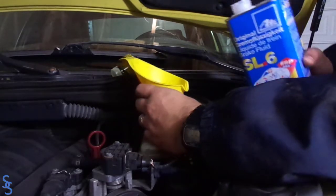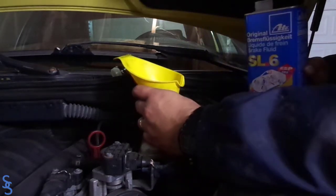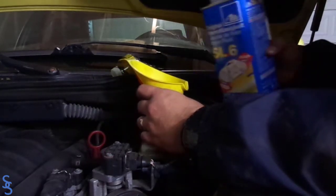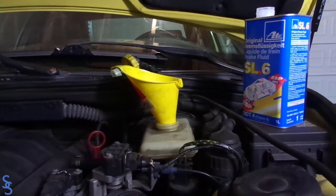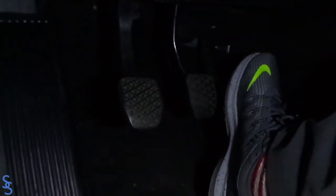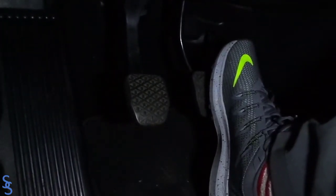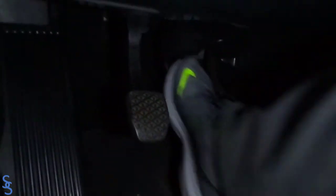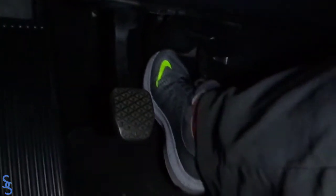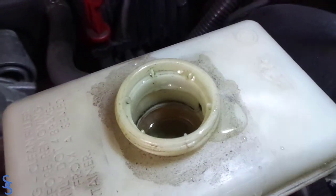Let's put one of these on so we don't make a mess. After you fill the reservoir, apply the brake a couple of times. Depending on how much fluid you let go, it's going to depend on how many times you have to do this. Before we even get to the calipers, we need to put some fluid in the system. By pumping the brake, you can take that fluid from the reservoir all the way into the lines. As you pump the brake, your level is going to go down — keep doing this until you see that the level doesn't go down anymore.